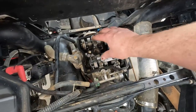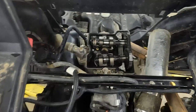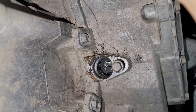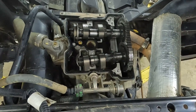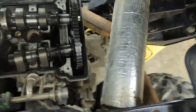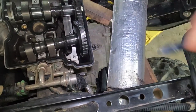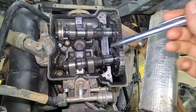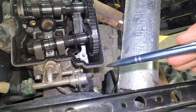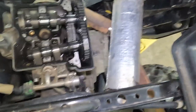I'm going to take this whole cage off again, pull those tappets out, throw these new tappets in, and remeasure my clearances to see what we got. We're still set at top dead center — I showed you how to do that already — and I have not jumped any teeth on the sprocket yet, so I know we're good there. But the tensioner, which is way down here, this little cap right there, is pushing against the chain and it keeps making it impossible to set these valves, or cams, back where I want them. So we're going to take off that cap. I think it was inch and a quarter or something — let me grab that tool. It's actually an inch and a sixteenth.